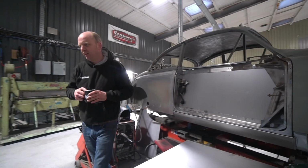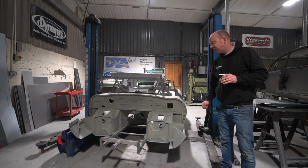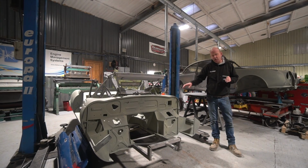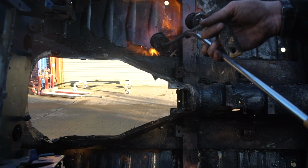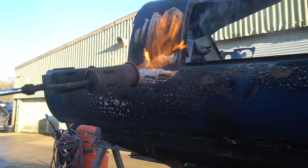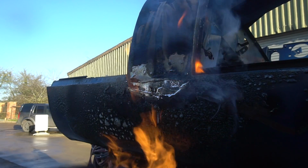So that's that. And then behind camera, if I step round this lift pillar, we have a Series 3 V12 E-Type Jag, which you may be aware of as the new project in town. The progress on this week has been blasting it. You'll probably see that in another video we're doing in another series, our autofocus series on vehicle restoration, our take on it and our opinions on things, and we'll be interested to see how much we get corrected. There's quite an in-depth discussion on a few bits to do with this in that video. However, the main progress this week has been that the undercoating, seam sealer, organic coatings, everything else have been burnt and stripped and scraped off this. And then this has been blasted with crushed glass and lightly etch primed.